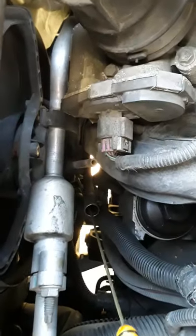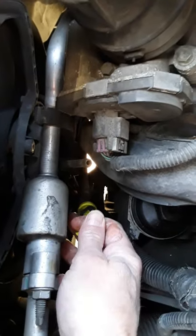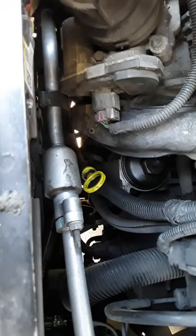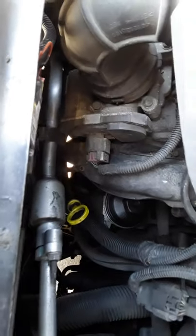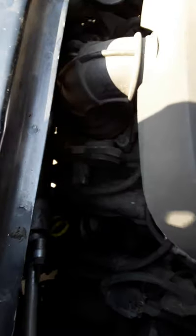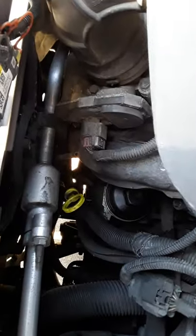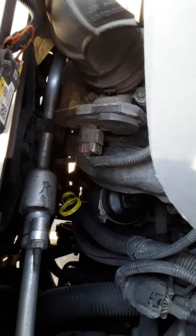It's probably between a third and a quarter of a quart down, so I'm not going to add anything. Make sure you put the dipstick back in — get it right in there, nice and tight. You don't want to leave it out because that is an opening to the oil pan and there could be some pressure causing oil to spurt out. In the next video, I'll show you how to change the oil, swap the filter, and top it off.